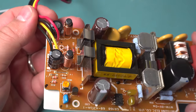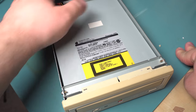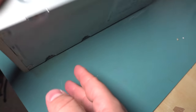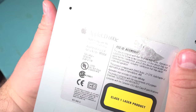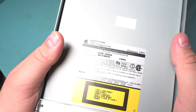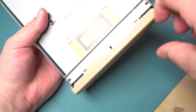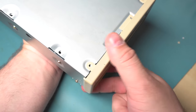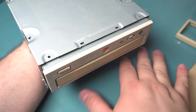I've taken the cover off the 600, and it's basically the same design as all external drives — just the drive and the power supply. This one looks a lot cleaner because it's got a nice metal shield over it that looks more professional and modern. From the bottom you can see it's the 600e — the 'e' being external; there's also an 'i' which is the same drive inside a computer — and hey, look, there's a 600i, so they just packaged them in an external case. This one is labeled Apple but it's really made by Matsushita. The front bezel uses these deteriorating clips and the bottom is already broken — they're just falling apart.